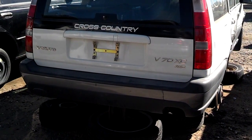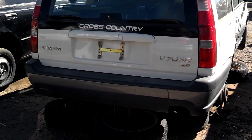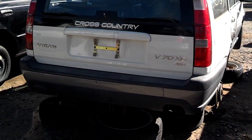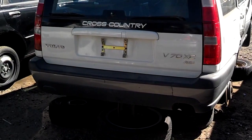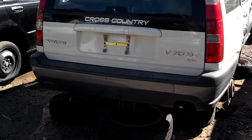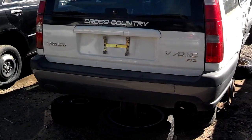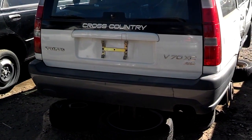If you've got a Volvo 850, XC70, or V70 — whatever — up until the 2000 model and you're up north, chances are your bumper's loose and hanging down, unless you've already replaced your bumper mounts — the bumper brackets, rather. These things have a little flaw of a design in them, and they rust out, and they are totally not supporting the bumper.